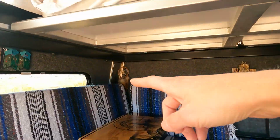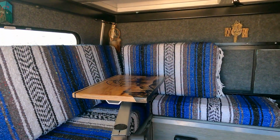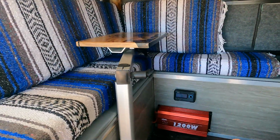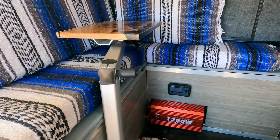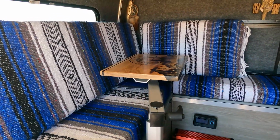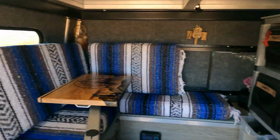And it's being fed by the 2 solar panels up on the roof of the camper, in addition to being connected from the main battery back to here so that while I'm driving, the alternator is charging all 3 batteries. So that's great. Give or take that there's not a sunny day, hopefully I will still have power and be able to run my lights and charge my phone.